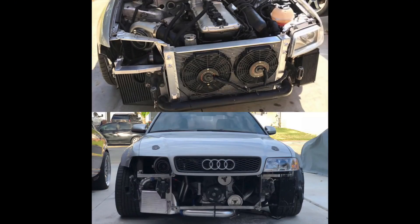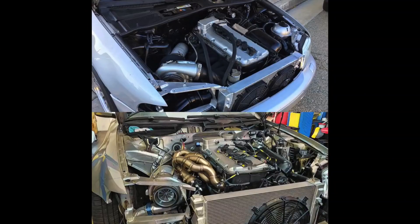Haltech is not just the reason everything's running so great, and we're very grateful for Haltech. We also changed to a water-to-air intercooler, which simplified the piping instead of using the twin side mounts. We changed to a tubular manifold as opposed to the one that had cracks and leak issues before — now running a tubular manifold made by Ed at Force Fed Engineering over in New York on Long Island. We're running a single brushless pump now, so things are a lot more legitimate and efficient. That's why the car, even on 91 octane on a base file, is running so smooth.